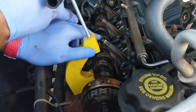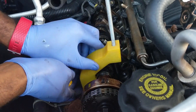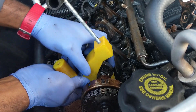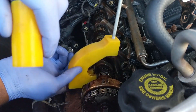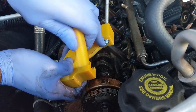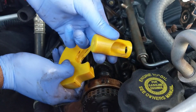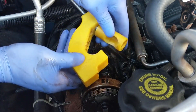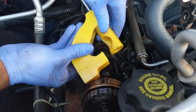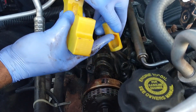You may also need to lock the camshaft when you compress the cylinder so it doesn't rotate. What you do is slide this tool — there's a little notch here and a little groove inside of it — and go ahead and slide the tool right on the cam for the valve you want to replace. There's a 5/8 screw that goes through. You slide this little adapter piece onto the bolt, and as you tighten the bolt, this essentially acts as a clamp to push this piece and compress the spring.